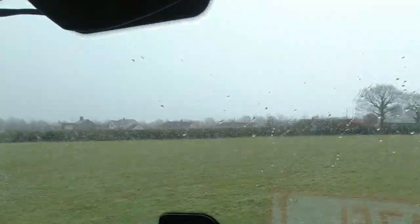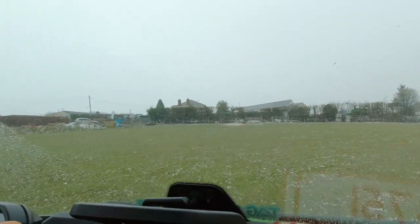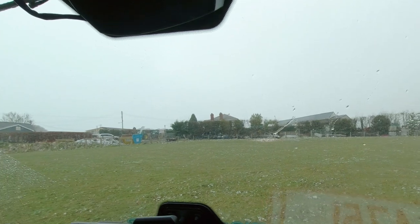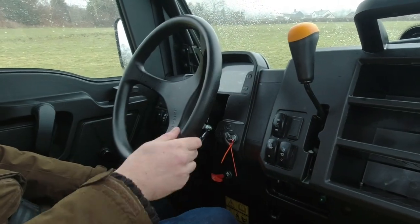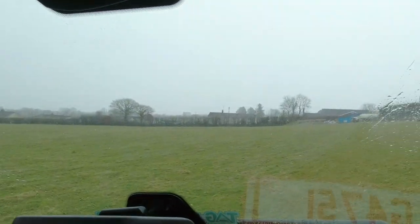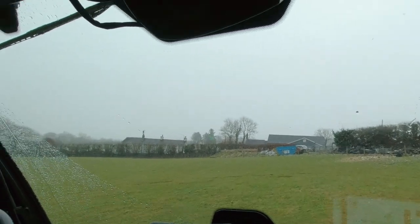Bumbling around the field — it's really good. It's almost like off-roading in a Range Rover; the ride is that comfortable, even across a fairly rutted field. I select four-wheel drive and can hear the electric motion happening — no centre diff, so tight turning on rough terrain will start churning up the ground. I put it in low ratio, which means you can tow 900 kilograms up a steep hill, gives you much more control over pace through tricky terrain, and more torque to get up slopes. Racing along at nine kilometres an hour.